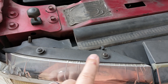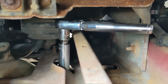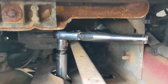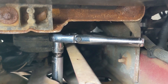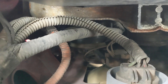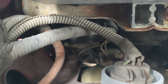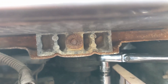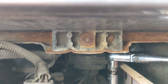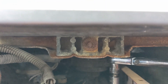To take this trim out, the obvious fasteners are the two cross-head screws on the top. Then less obvious — there's an 11mm bolt down in here; on our truck that was 11mm, though I've heard some trucks need a 10. You'll need a long socket to get in there, and there's one on each side. You can get to them with the battery in place, though it's not too tough to take the battery out — just the little wedge bolt, disconnect the cables, and lift the battery out of the way.